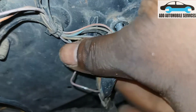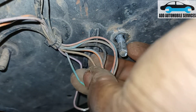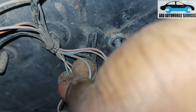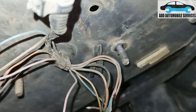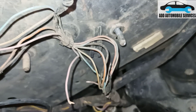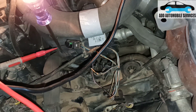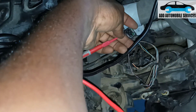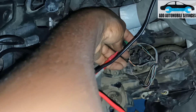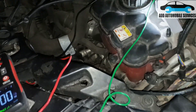There is green corrosion on this wire. I'll tear it off and check the other wires also, and examine them — if they are okay I'll fix everything back. I fixed the wire and continued the diagnosing. When I come to my sensor I'm also having ground on the signal wire and ground on the main ground wire.